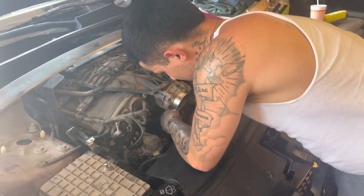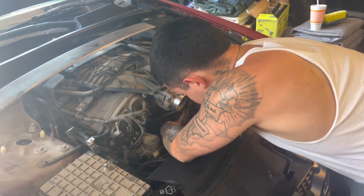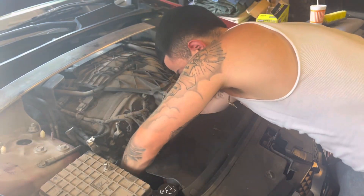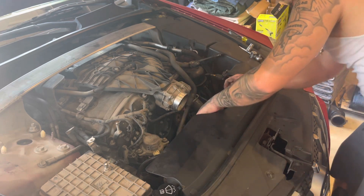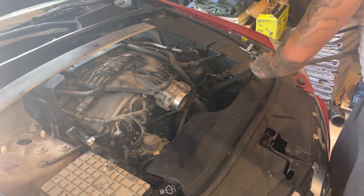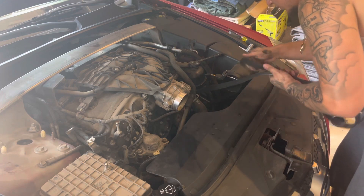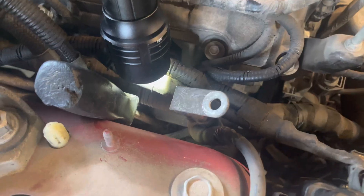I got the half-inch socket wrench and I'm going to pull up and it will loosen the tension on the belt so I'll be able to pull this belt off. There we go — got it. I probably shouldn't be taking it all off, let's just leave it right there.